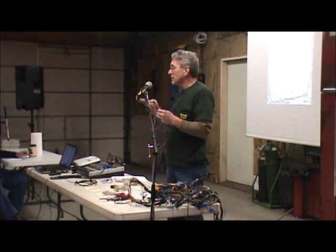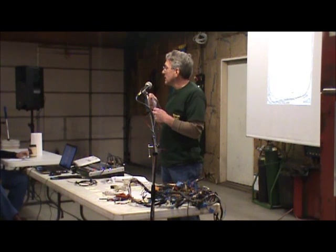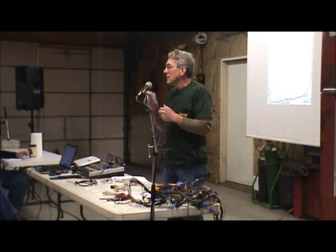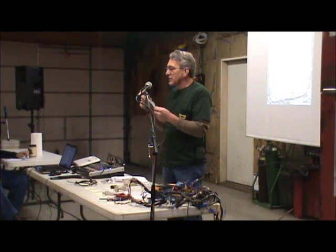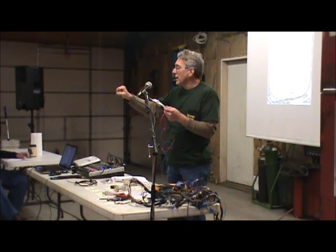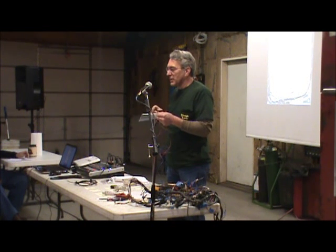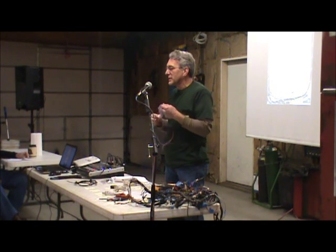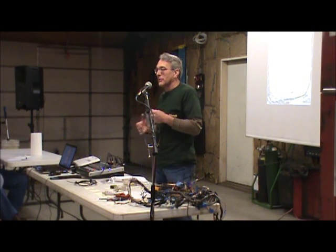Hey, Mike, I'm sorry, make sure you tell everybody that they're banned. They're banned here? Yeah, I don't trust those. No. I've used some, and there's another type too called Scotch lock, which actually clips. Low current is fine. High current, yeah, you've got to be careful. Also corrosion. Well, you still have that, but they do seal a little bit better. They're certainly better than this. But yeah, if you want it done right, solder it, absolutely solder it.